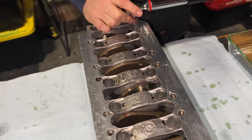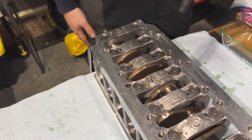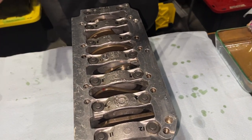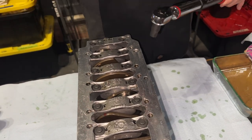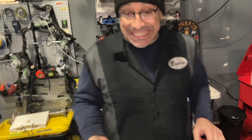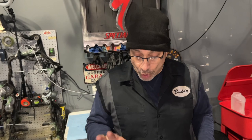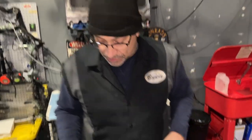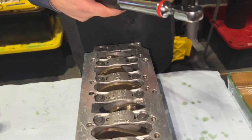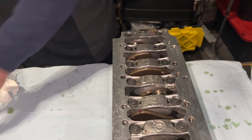Oh, and don't attempt to turn this right now because it won't, and you'll get frustrated. You should turn moving parts as you assemble, of course, but at this stage it will not turn. Things are not lined up, matched. It will only turn if assembled properly and torqued to spec. So now we've got our 15 Newton meters, confirmed that that's the case, and so we're going to go ahead...